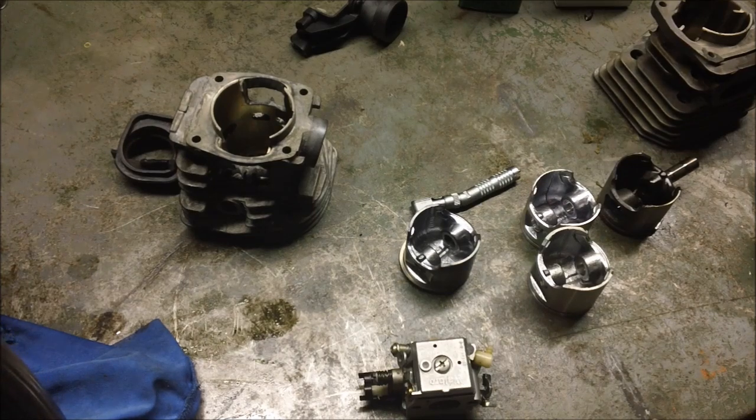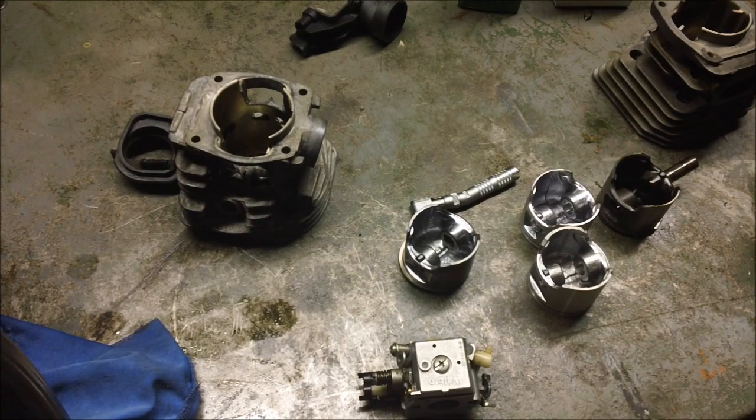And since I was in that saw, like I said before, and it had the coarse thread bearing cap, I pretty much covered those screws with 1194 before I put them back in that bearing cap, both the cylinder hold down screws and the screws that hold the bearing cap to the case. Lots of 1194 in there.